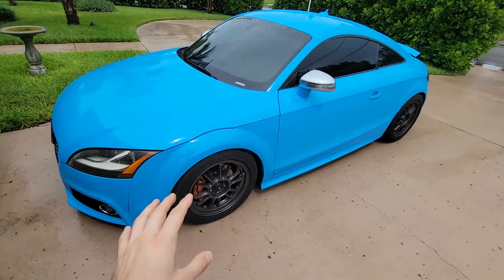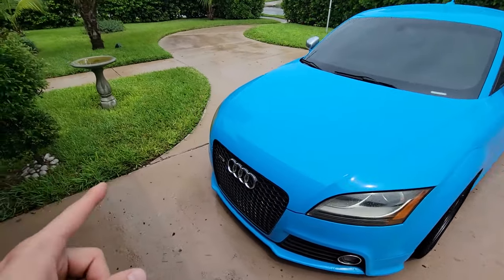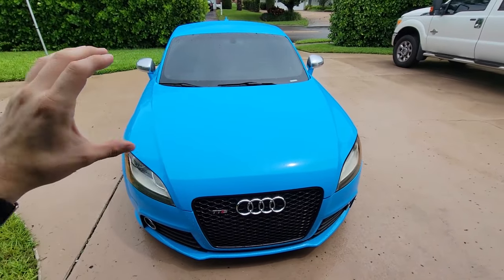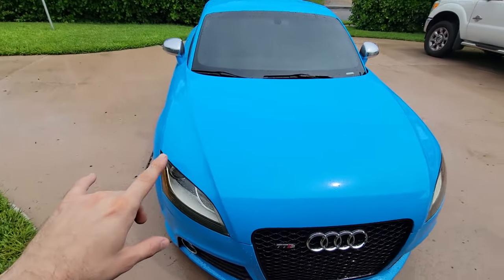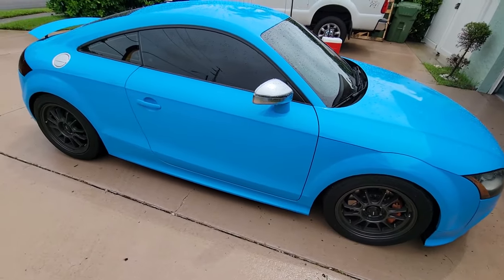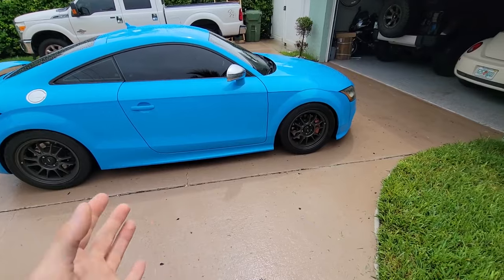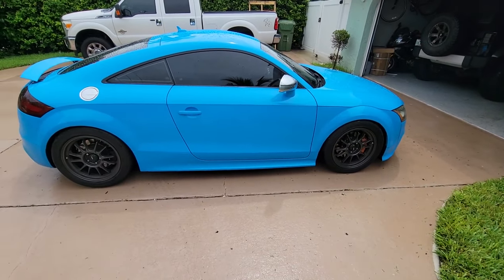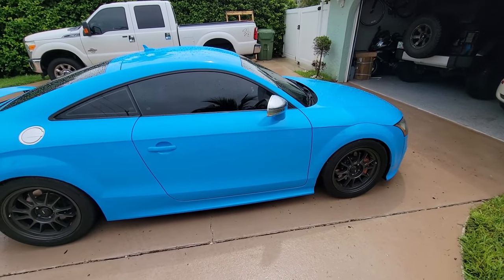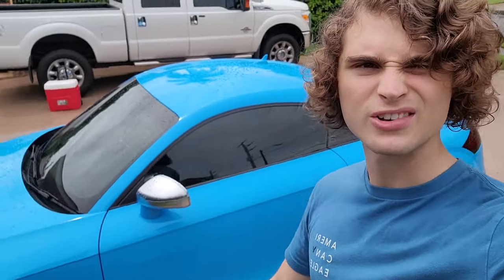I'm never going to have that open just driving around for regular use. The only thing I'm going to change is I'll add a dump pipe that has a little bit of curve to it, just so it's not pointing at the car so much, because it really vibrates the car. But other than that, I'm happy with it. I think it's really going to help with exhaust flow, and we'll do some logs and hopefully see some difference with the turbo making boost. Thanks for watching guys.